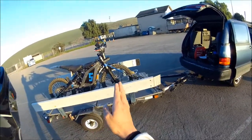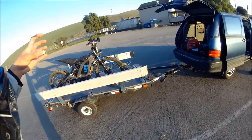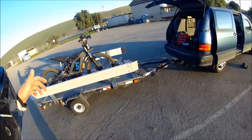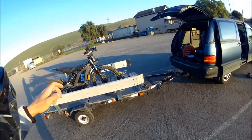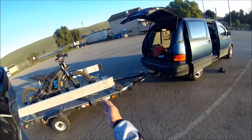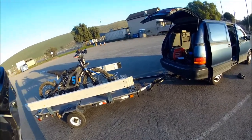I didn't like that. With the variable throttle Regen, you get the Regen when you want by giving it the paddle. You can have Regen whenever you want at whatever speed. So that's what I like. And it's pretty easy to vary the amount of Regen. You can go half Regen, full Regen. If you just want to lock the rear up, just get on it right away, you know. And like I said, it's set at 50% max Regen right now for the motor power, and it's locking the rear up.